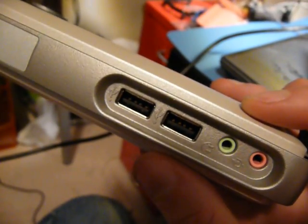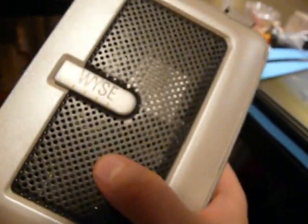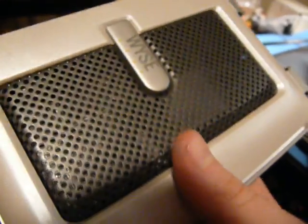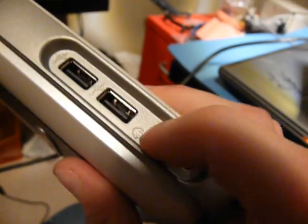Fortunately, I do have the original flash disk that came with this thing. Unfortunately, I can't write it because if you boot this thing from USB, it freaking disables the onboard IDE controller, so no operating system can access it. Like, I can boot Linux and I can poke around all I want, but I can't get it to detect the damn drive. So I can't even flash Linux on the drive, which isn't a huge deal.